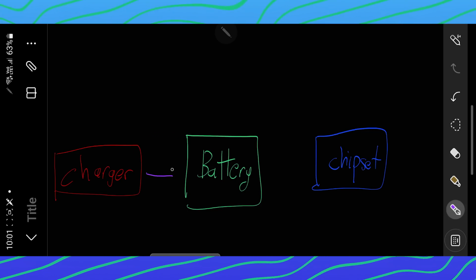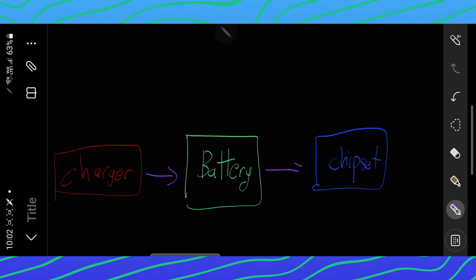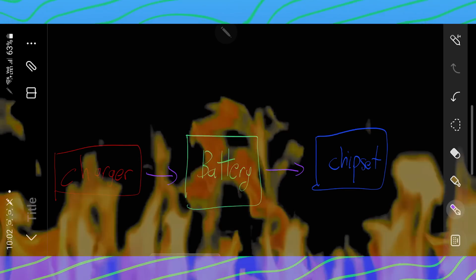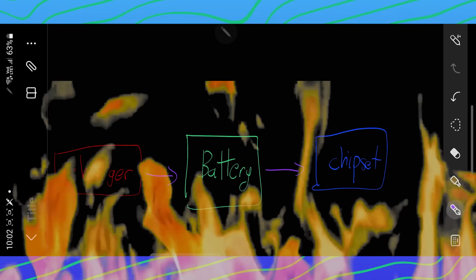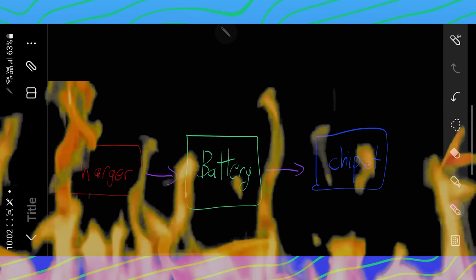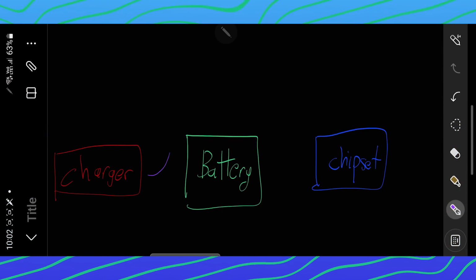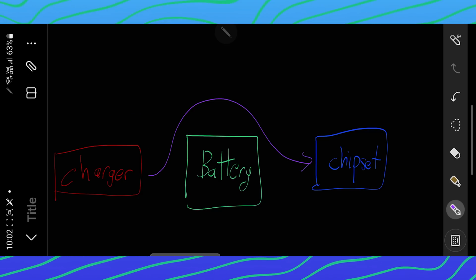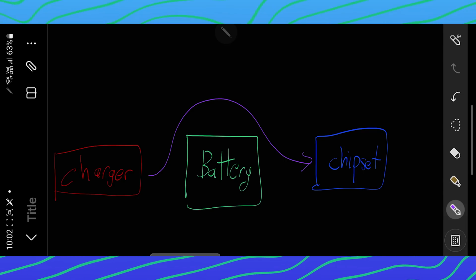Usually a phone is connected to the battery while gaming, so we have to charge the battery while the battery itself is also being depleted at the same time, hence generating more heat and also drastically deteriorating the battery's health. With bypass charging, you can just skip the battery entirely and play your game, hence it is healthier for your battery and also less heat overall.